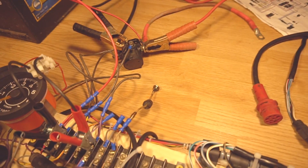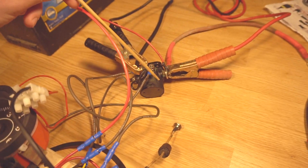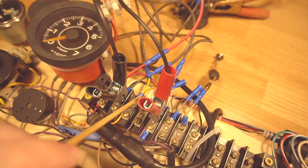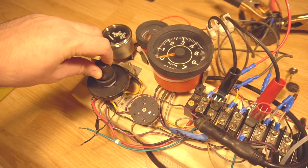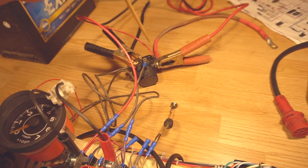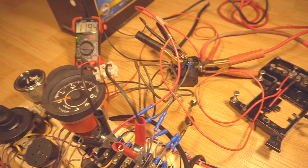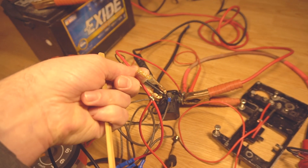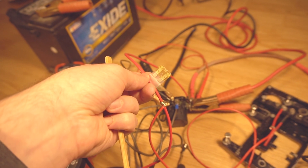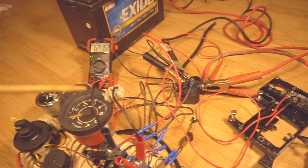Here I have the solenoid. The positive connects to the battery and the negative, and this right here is the starter wire — it's connected to the yellow with red stripe wire. This is the ignition key: when you turn the key and you expect to hear the motor cranking, this is the ignition key. This red wire here is connected straight up to the solenoid, so it's not the ignition key — it's just the key that provides power to this entire system. The system power is protected by a 20 amp fuse. This is a standard fuse you'd get at an auto parts store, and for this motor it is a 20 amp fuse.